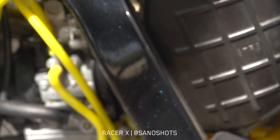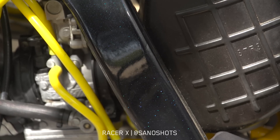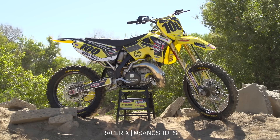The frame was taken completely down. It had some dents in it that were welded in and sanded to get it straight and looking good again. Then San Diego Powder and Protective Coatings did a powder coating procedure on it — it's actually got a pearl, like a bluish-purple pearl, and it's really cool looking. Millennium Technologies also replated the cylinder. This thing had quite a bit of time on it, and those guys do a service that gets it back to standard tolerances.